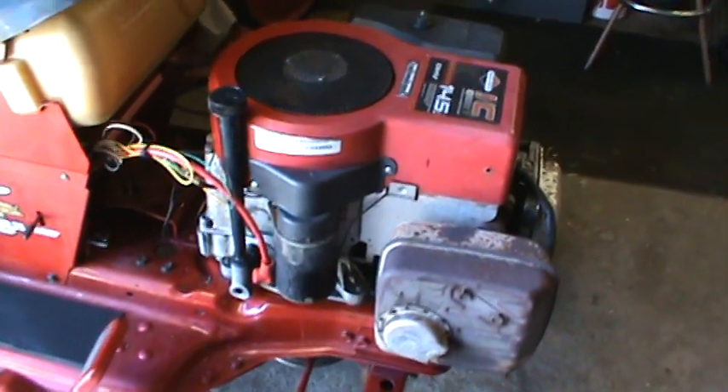Yep, we got all the wiring done. Charging back to the battery — good deal there. These black and white wires here are actually for headlights, so I just tied them up in the back just in case, by some stroke of luck, I find a good hood. I can put a good hood on this with a nose cone. She's in.